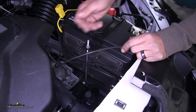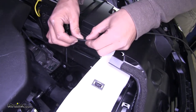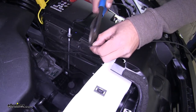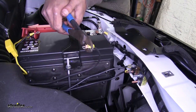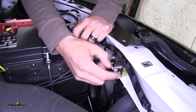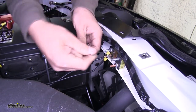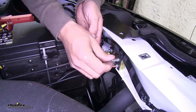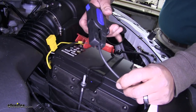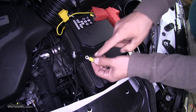With our black wire, hook it up the same way we did with our other breaker. Route it over towards the breaker, estimate how much wire we're going to need, cut it and strip back the end, holding on to the excess black wire. Grab one of our small ring terminals and crimp it on. We're going to be going to the silver post on our 20 amp breaker. Remove the nut, slide the ring terminal over the terminal, then replace that nut.